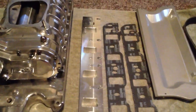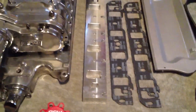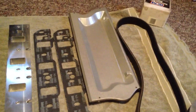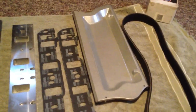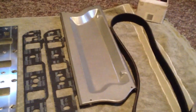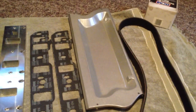It's made out of billet aluminum, and it came with a kit. I'll put a link in the description so you can price them out yourself, but it was around $300 for these adapter plates and this valley tray. My intake manifold is going to be raised up about an inch and a quarter, which means you'll be seeing my push rods and whatnot underneath. This tray is going to be tapped onto my block so all of those goodies are covered up and I don't have to worry about any of that.